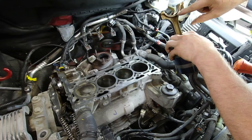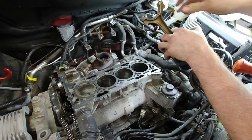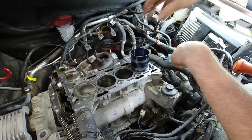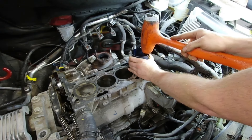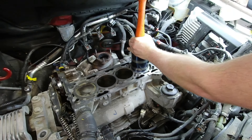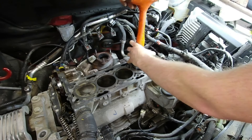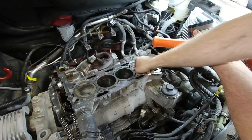Before I do it again, there's a little gap there from tapping on it, so I'm going to make sure it's seated down so it doesn't fall out. Very carefully, trying not to scratch the cylinder walls, I'll set this in here again. Keep in mind: when doing this, I'm pushing down on that ring compressor — that's the best practice. I didn't do it on the last one to see if it would bind, and sure enough it did. The best practice is to hold down on the compressor and give the piston a light push. And it is in — all the way down, below the deck — so I know it's fully in because that's top dead center right now.